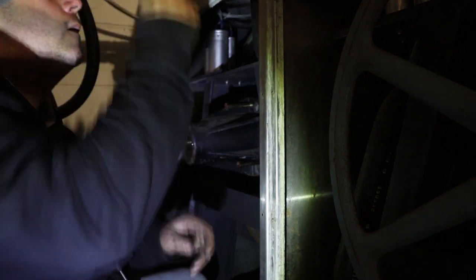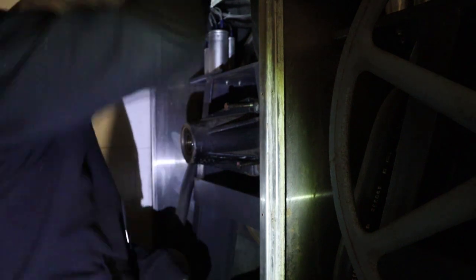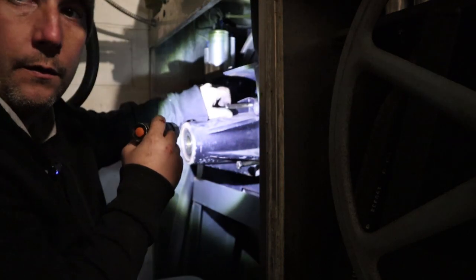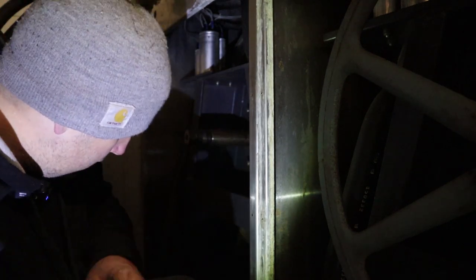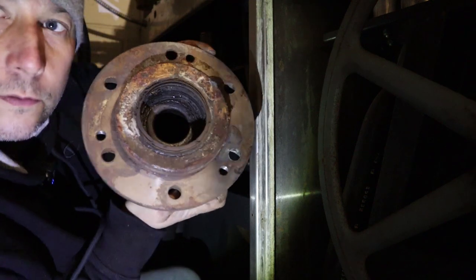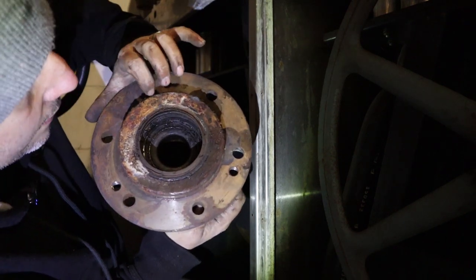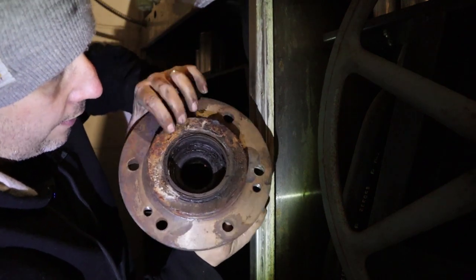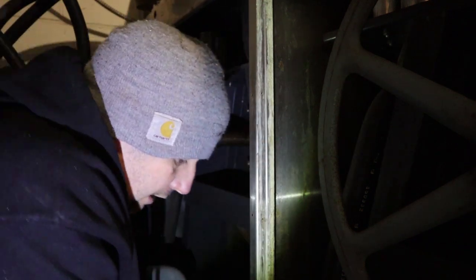Basically I'm going to pull out my bolts here. There's what it looks like — see that? Those are the seals and that's the bearing. That's tar, oil — that's the bearing giving way. Basically these seals wore out. You can see the water here, you can see the corrosion.